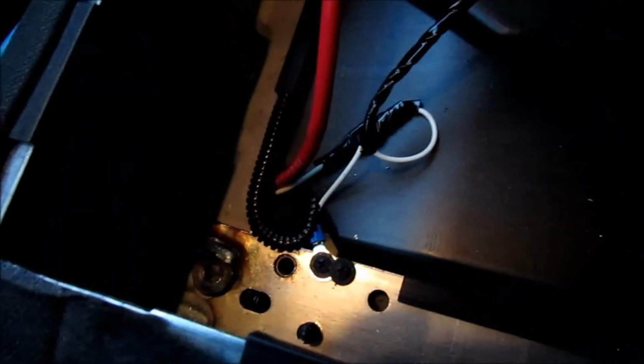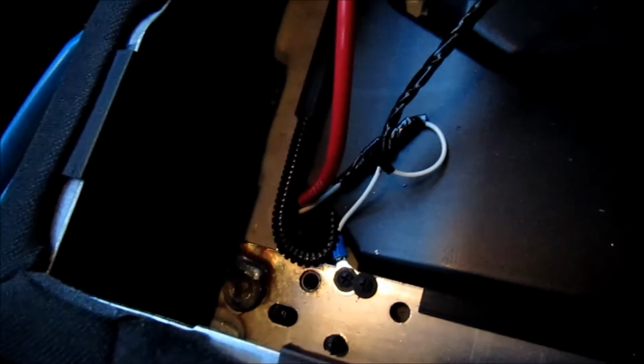So this metal frame here is actually pretty sharp metal, so there's a good chance that this airline and this wire can chafe on it. So I've gone ahead and just gotten some 1/4" loom, and I placed it over on top of the edge. And if you want, you can stick something sticky inside there to help hold it on. This one's not going to go anywhere because it's pressure fitted in, and then that'll prevent the airline and the trigger wire from chafing.